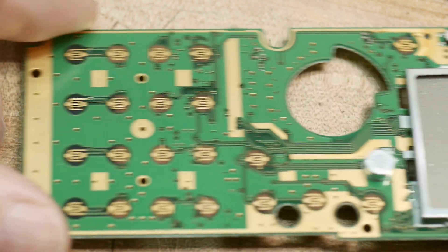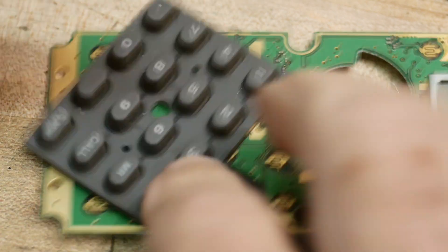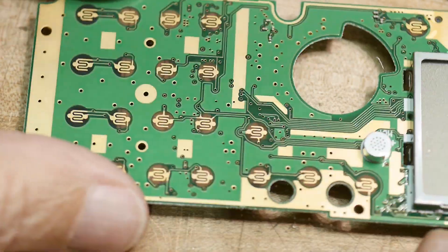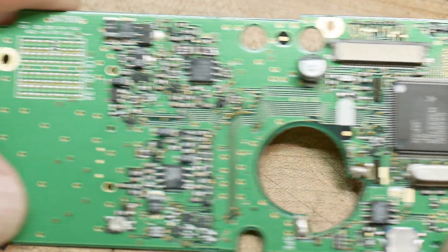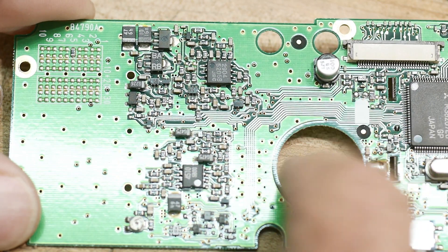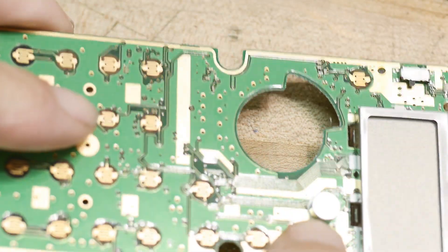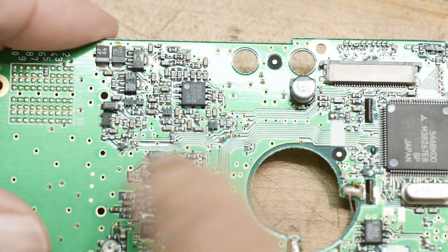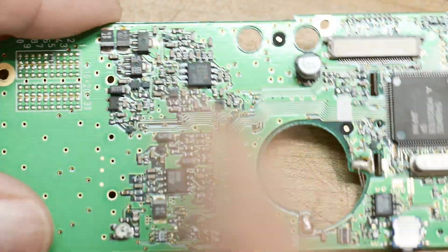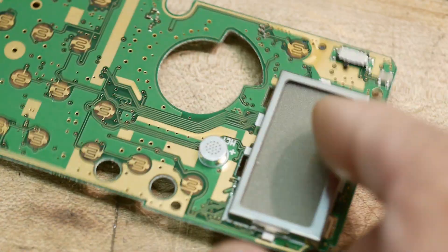Here's the display board with a nice little gold contact. The way the rubber keys work is there's a little bit of carbon there that pushes down and makes electrical contact. Not much else on this board. The circuitry down here might just be the audio amplification for the speaker, and the microphone is here, so it might be the microphone preamp too — microphone preamp and audio output. This is probably the audio output and this is probably the microphone input. And then this is the brains of the thing, and then a nice little display.